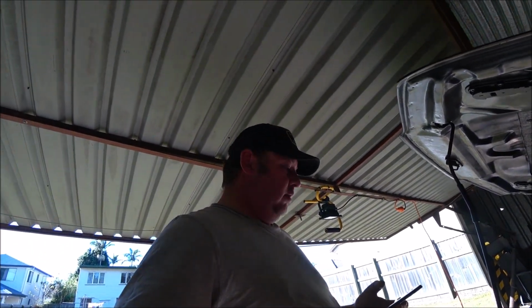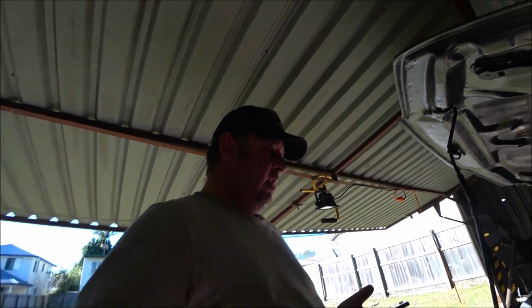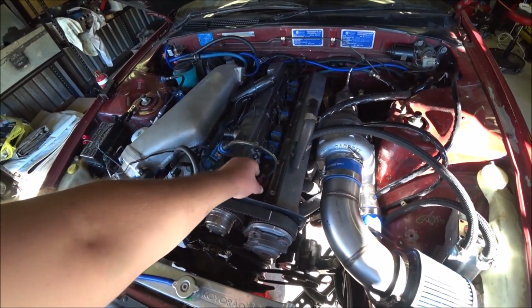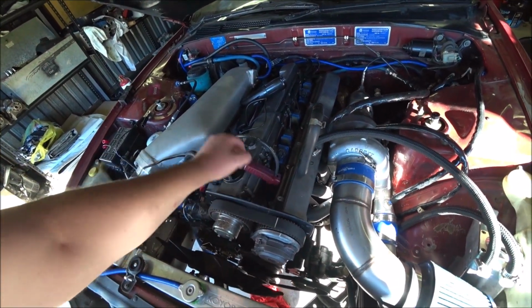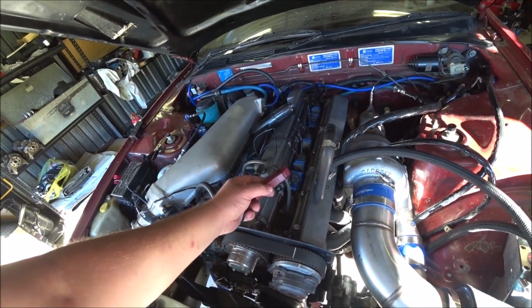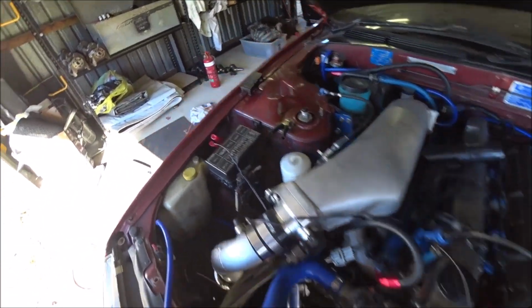Well, it seems I just did all of this without the camera on. I've put a timing light on here, and I showed you how to pull this out and everything. There's just two bolts, screws down on here. You pull the coil pack out. This plugs in there, goes on there. This goes around there. That senses when the firing is happening. We give it power.